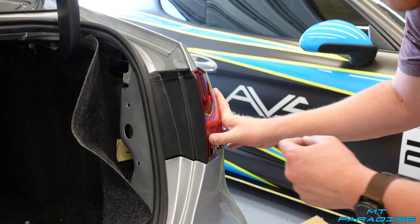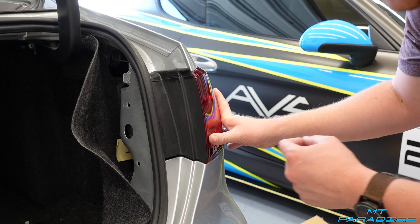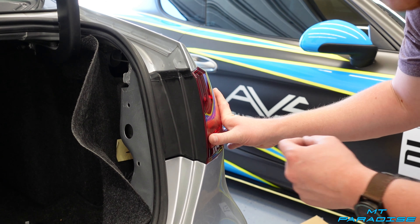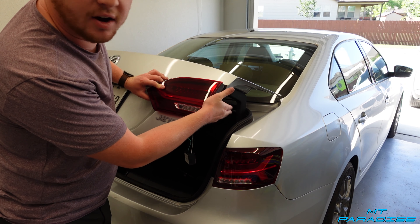The reason I suggested pulling the carpet back is because this new light does have this little box to it — not 100% sure exactly what it does, but it might have to do with the sequential turn signal. I'm going to start by sticking the wiring through the hole where the plug is, getting it pushed back out of the way, and shoving all the wires in there, then pushing the light into place. Now that the taillight is in place, I'm going to put the little wing screw right back in. For the time being I'll leave the box hanging — you can stick it up against a flat surface cleaned with isopropyl alcohol — but I won't do that until I test everything.